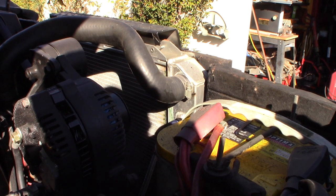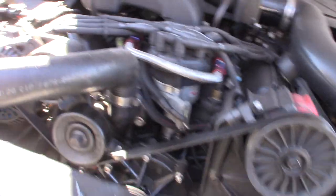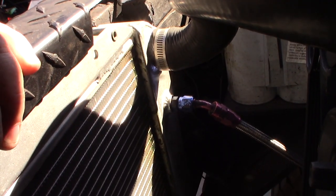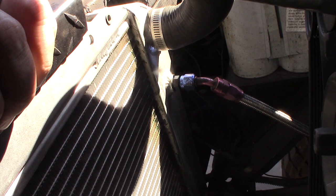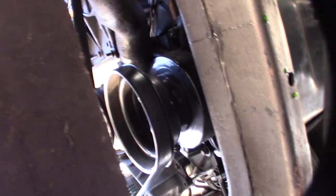This is the second one I've actually had to go through. This is actually a serpentine conversion — it's a 5.0 inlet and outlet. I could make a video about the serpentine conversion. Look at that leak on that side and that side. I don't know if I can get in there to do it — at least with a copper one I could braze it. I do have some Muggy Weld, but if I can't get in there I can't fix it. Stop leak is the only other option, but I'll probably just get a new radiator.